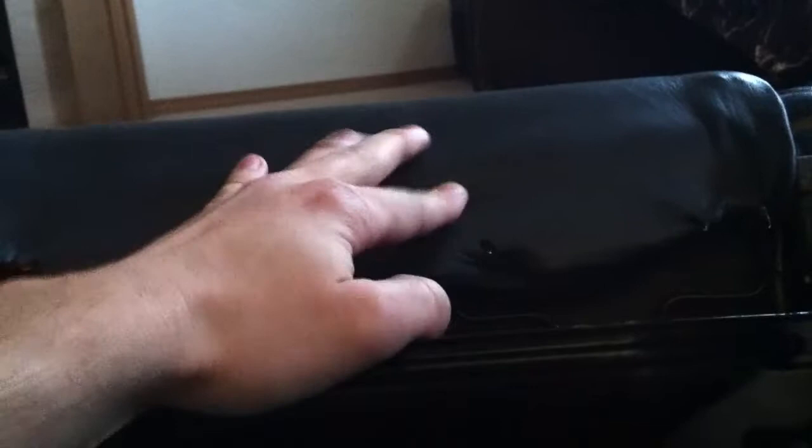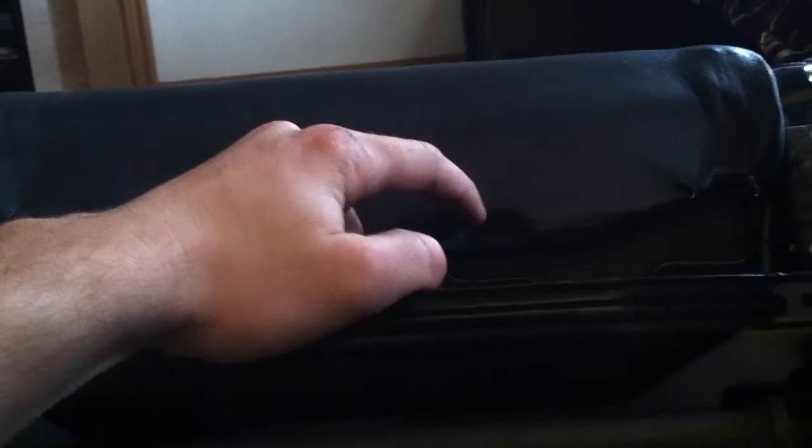So I'm going to be putting the leather back. I'm going to start working my way from the inside out — do these two first insides, then the two here, the two here, the two there, and work my way out. Now that I've got all of them on and the leather's on, what I'd recommend is don't force the pins through — stretch the leather over. You might have to massage it to create slack, but don't force the leather through the slots. I'm just using pliers — push the teeth down until it locks, and if you can, crimp it down.